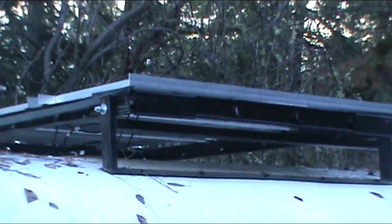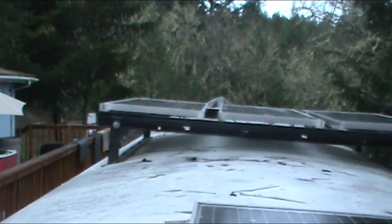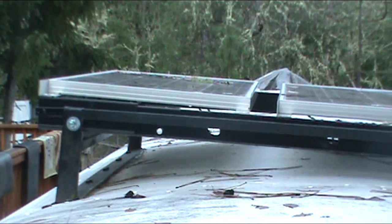So here's the rack on the bus. I use the foam stuff underneath there that's meant for a pickup camper — it's a black foam thing, and the rack is black so you can't really see it. The way it's attached, I can undo those bolts — I could make it fancy with a quick release, but I haven't bothered. The solar panels bolt to two aluminum pieces that go across the rack, and each solar panel is bolted to two pieces of angle aluminum, which are riveted to that aluminum frame.